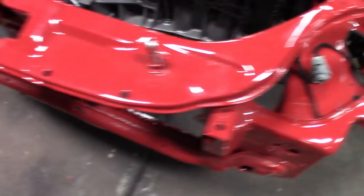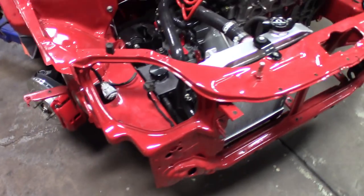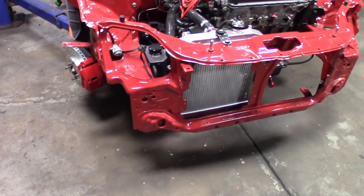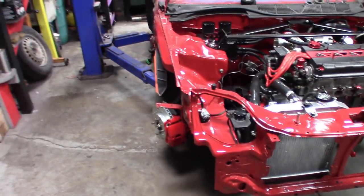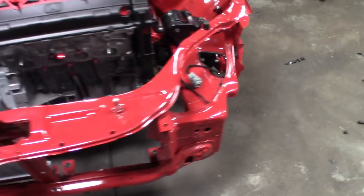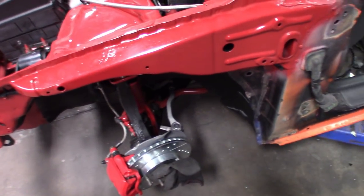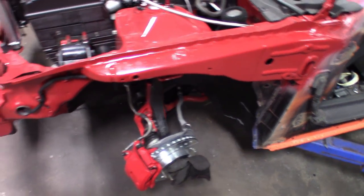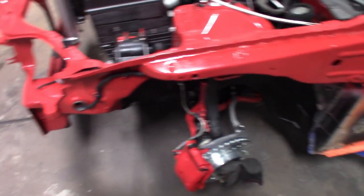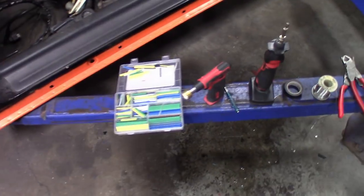Here's the driver's side headlight — got the plugs for it, turn signal and headlight, kind of just ran it under there. Got the ground dropped through, grommeted it, grounded it right there, then ran it up and across the core support and dropped it down for the other side. Also got the fan plug — wired that in for the new fans. It used to carry on into the harness and drop back to the fuse box, but I rerouted it so it all plugs in on the inside of the car. Here are some of the tools: obviously a torch, shrink tube, electric tape, solder, and a soldering iron.